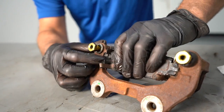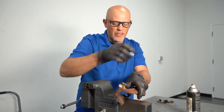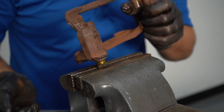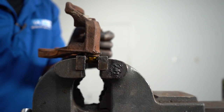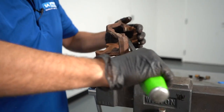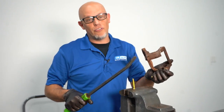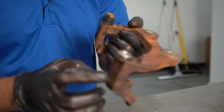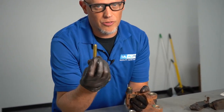What you can do in that case is take some rust penetrant and try to spray it in there. Let it soak — sometimes you have to let it soak overnight. But also take the caliper and pin and put it upside down in a vise. Then with that in there, you can take a pry bar and try to pry and twist it back and forth. As you're twisting, try to lift it up. Hopefully that breaks it free. In the event that it was that bad, sometimes using a little bit of heat on the brake caliper bracket can help release those. I don't like to use a lot of heat on the caliper bracket, but in emergencies you might have to. And then in that case, you probably need to replace the pin.